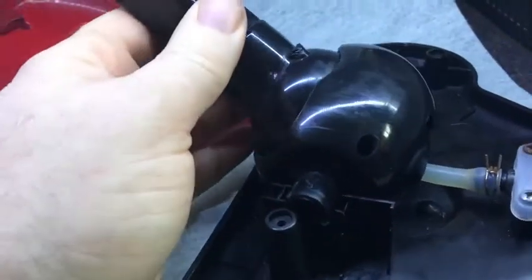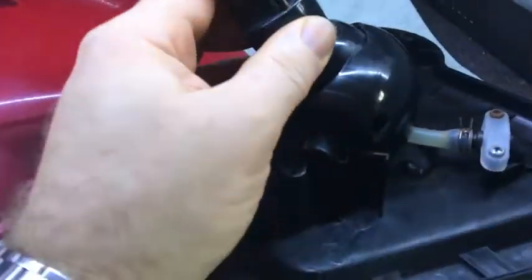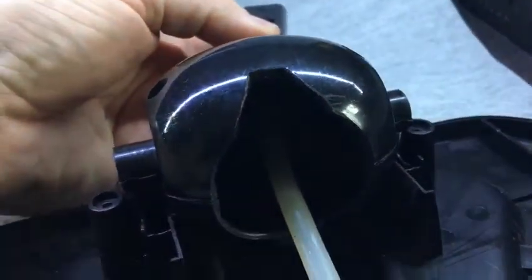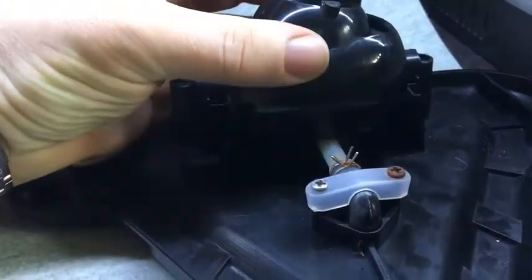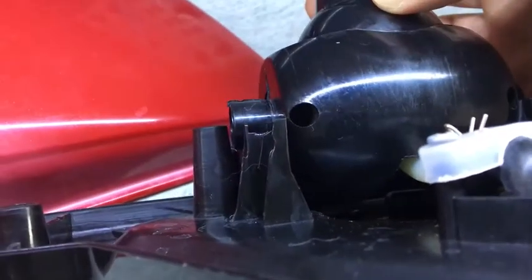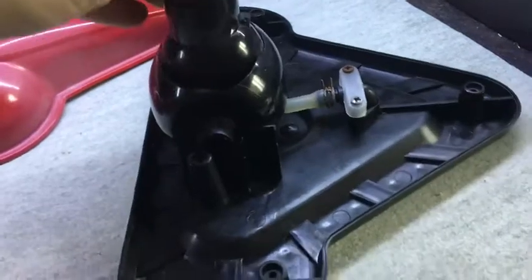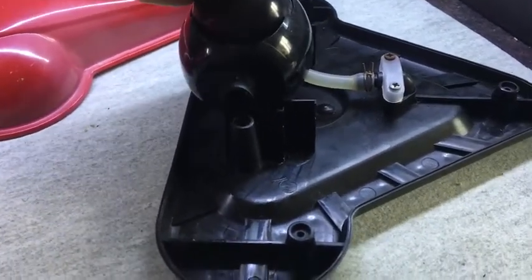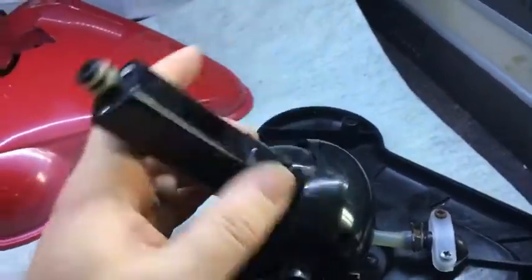Here's the unit back together. The glue is just about dry on the end. If you look here you can see that cut-out I've put in — whereas it used to cut straight across before, there's now a cut-out so when it comes down the hose goes into the cut-out, which is how it should be designed. Before you'd hit there, and now the fitting is sitting on the hose at just about vertical, which is where it normally sits, so it's not putting tension on the hose anymore. You can see how much slack is left in the hose now — that's much better. Whereas before it was just pulling it tight and that's what broke it. I'll just finish putting it back together, put the screws back in and that'll be done.